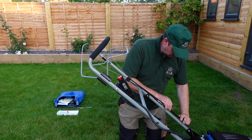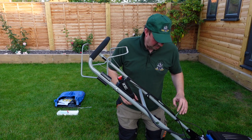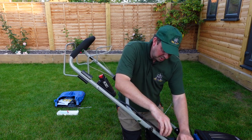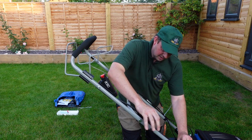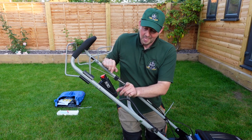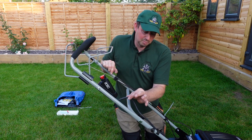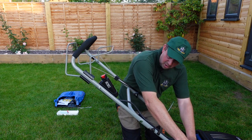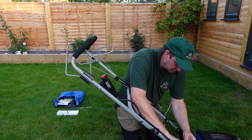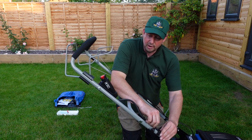That's those two cables connected. Now clip them onto the handle frame — we've got a double clip here, hold them tight together, put them on top, nice and tidy out the way. Put the second clip on the inside to keep it clear of the starting rope, up about here. Give yourself a little bit of slack at the top — if you ever have problems with electrics it's normally at the joints where they go in. Having slack means if the cable gets pulled, it moves first before putting strain on the joints. Put the second one down lower.